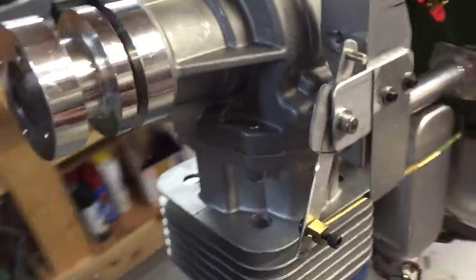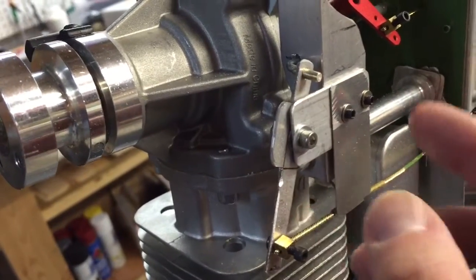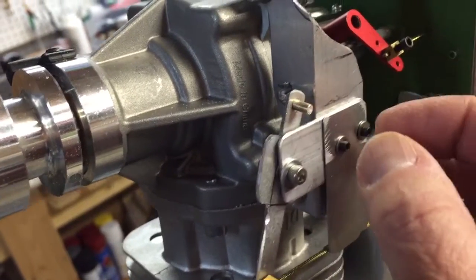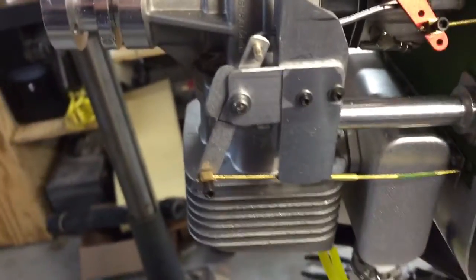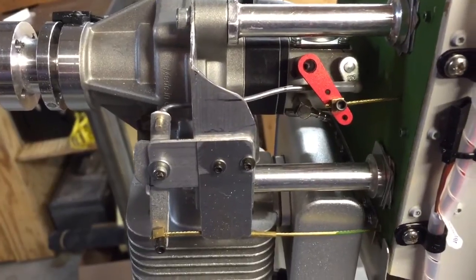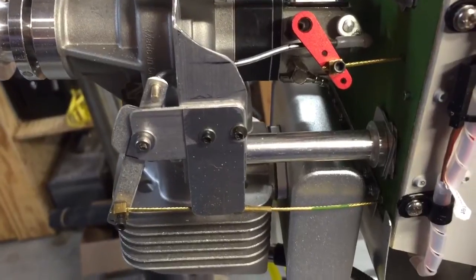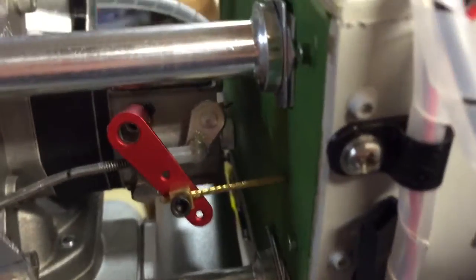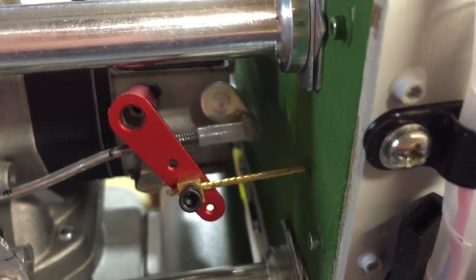The other end, through a suitable amount of mechanical advantage, as you can see, works through a solid arm. I'll demonstrate how the choke works here real quickly — it's hooked up to my transmitter. I have to have a long arm. You can adjust the travel to make sure that the choke fully closes or fully opens, or anywhere in between.